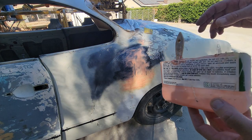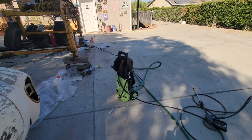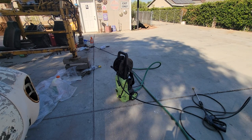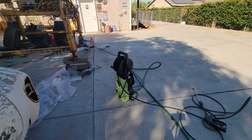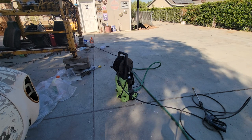It's not going to work on every car — it worked really well on this one. I found this product is a little more difficult to rinse off and neutralize, so I use one of these little electric pressure washers and wash it down slowly after I'm done. If it's still on there, it'll stick to your sandpaper and make a mess. It's not like other strippers where you worry about it burning your body, but it's still toxic — if it got flung onto a nearby car while sanding, you probably wouldn't be happy with the results.